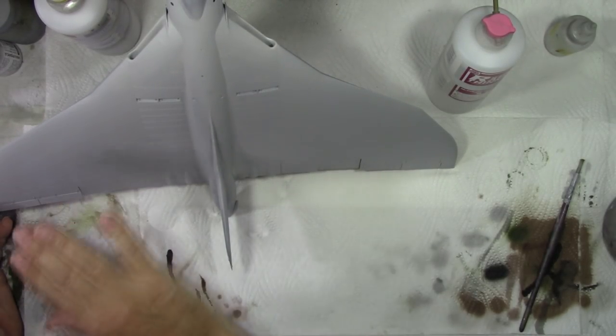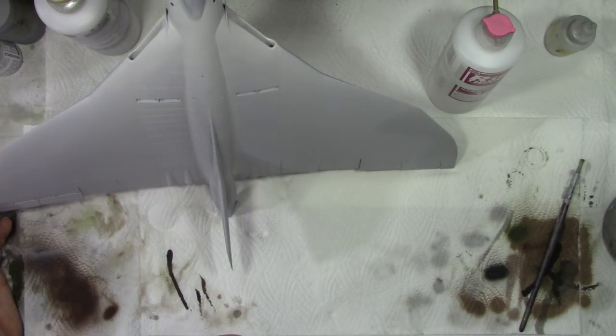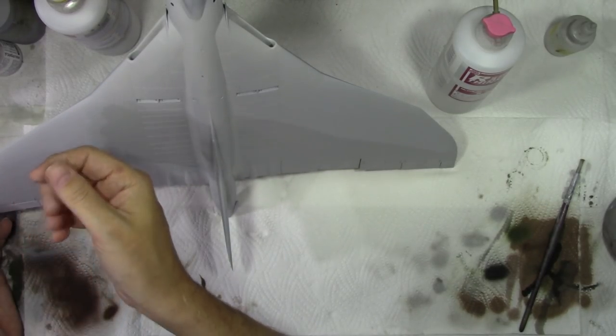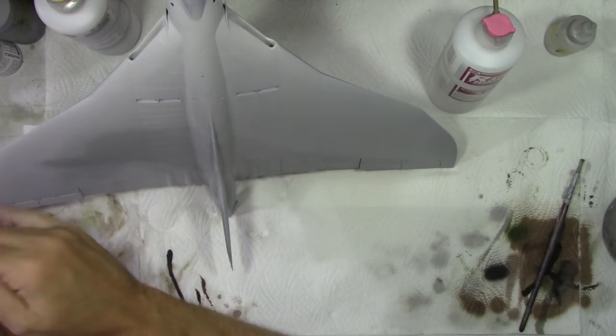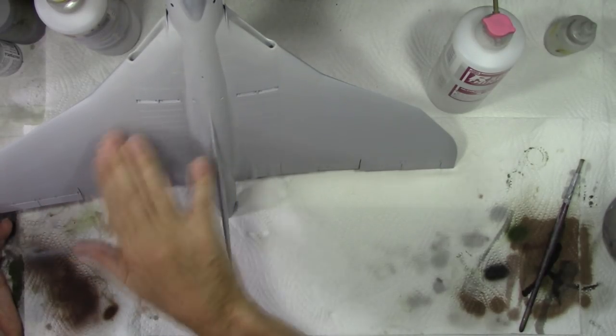So if we did need to perhaps sand back a coat or something like that, because there's no texture to it, it will sand back very smooth. If you had a lot of lumps and bumps in this, obviously those high points would sand back. And if you got green on here and had grey underneath, obviously the grey would show through in those high areas. Because it's all smooth, it should be absolutely fine.